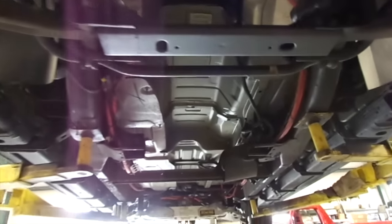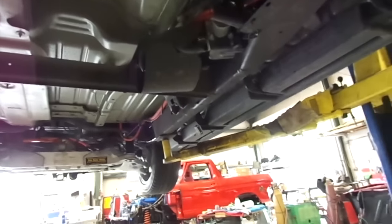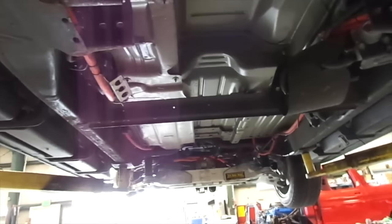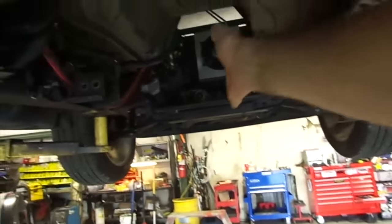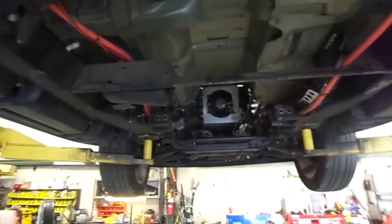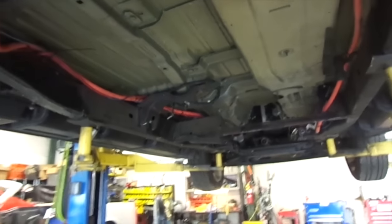You may have seen some of the earlier videos with the Tesla battery pack. If one mounts it here it's basically about four and a half inches below the frame rail, tucked quite below. For others considering conversion, there is a lot of room — if you could rebuild the battery pack differently, you could probably stand the cells vertically and build a special pack that would fit between the frame rails for a neater, cleaner installation. You can also mount a lot of the battery packs up towards the original motor area and put all the BMSs there. If you're doing a conversion with a vehicle that doesn't have a truck bed, there may be some options. That completes the hardware mechanical side of the Tesla install on this Escalade.